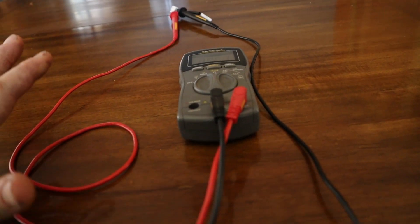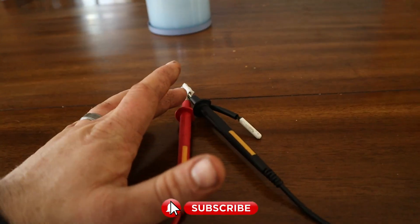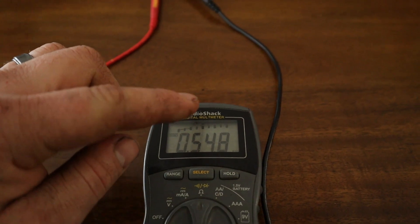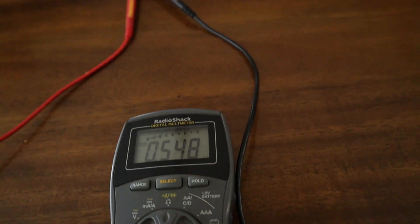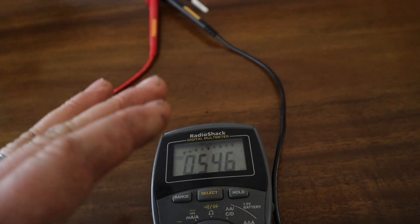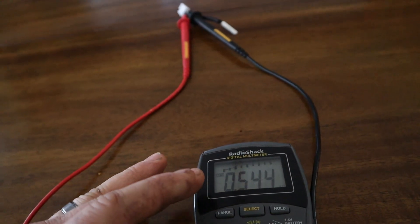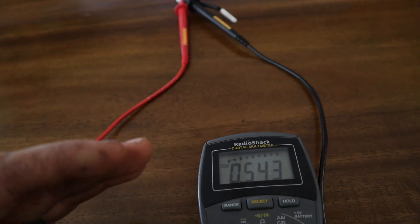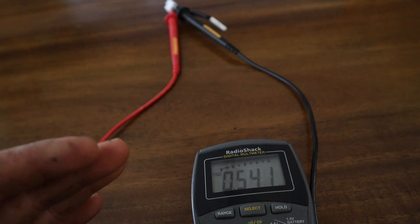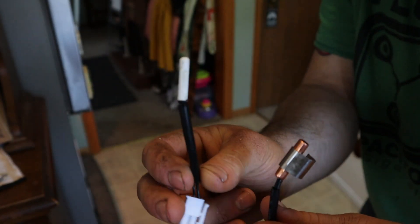That's what the old sensor looks like. As you can tell, the replacement is updated and better quality. I'm going to let this sit to room temp to double-check and test it — either way I'm putting a new one in, but that'll verify for sure that this was the issue. To show you how I know the sensor is bad: get yourself a meter and back-probe the terminal. It's reading 0.548 kΩ — you want it to read about 2.1 kΩ.